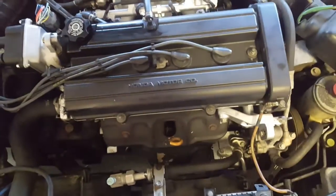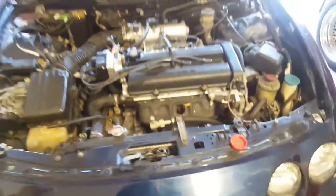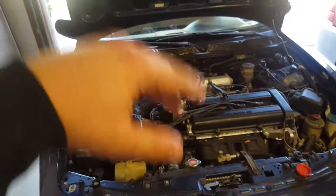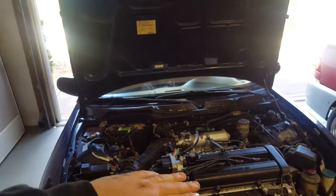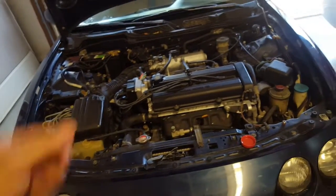Now we're going to let the oil sit down to the bottom of the oil pan again, so let's wait about a minute for that. And what you're going to want to do now is recheck your oil level using that dipstick method that we showed you at the beginning of the video. If it's back at the level that shows full, in between those two dots at the second dot, or the upper dot, you could say, then you're all set to go. If you're missing a little bit, go ahead and add a little bit.